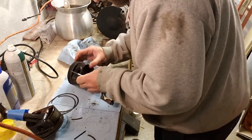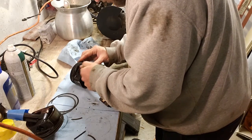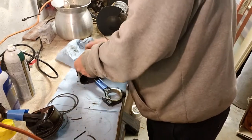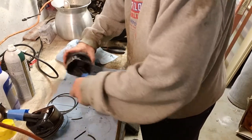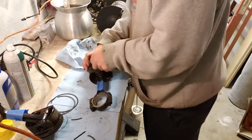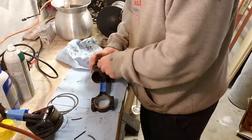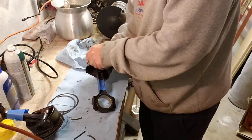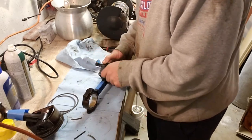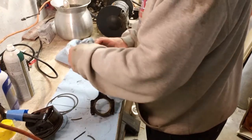And just run and start. Where do you start? There you are. These are 1.5, oh no, I forget what size these are. Let me shut up. Regular rings are 1.5 millimeters. These are much thinner and flimsier, so they're not going to break as easy. They flex and bend before they break.